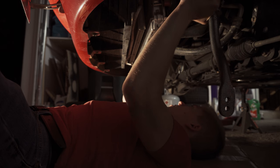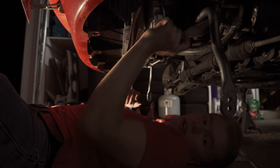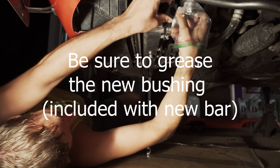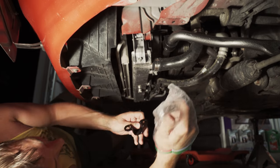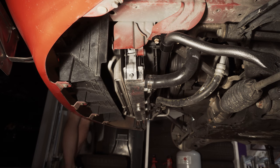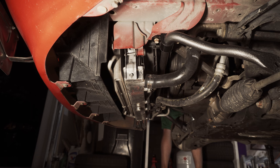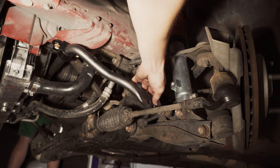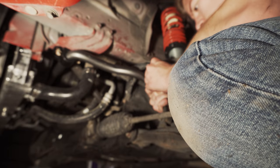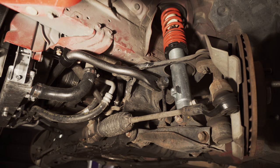Big ol' bar — got it. We'll get the brackets lubed up and slotted on there. It comes with new brackets because it's so much thicker; the OEM brackets are going to be too skinny to get on that pipe. The end links go on the outermost holes on the front bar and the middle hole on the rear. It actually slots right in there — kind of nice. Do the same on the other side.